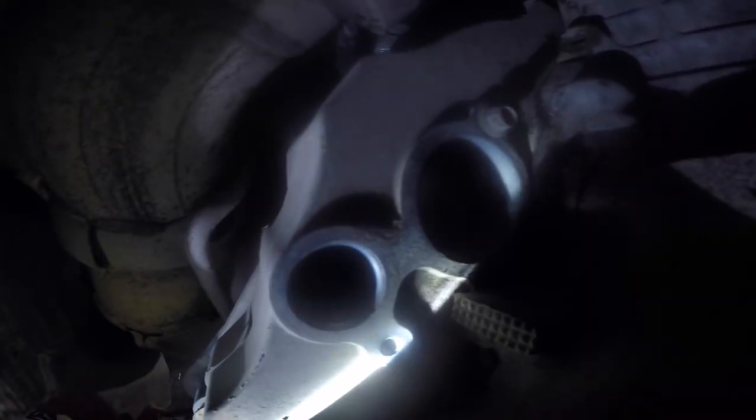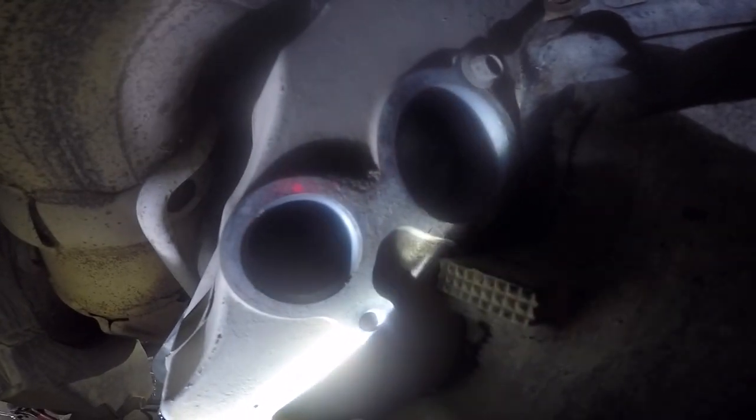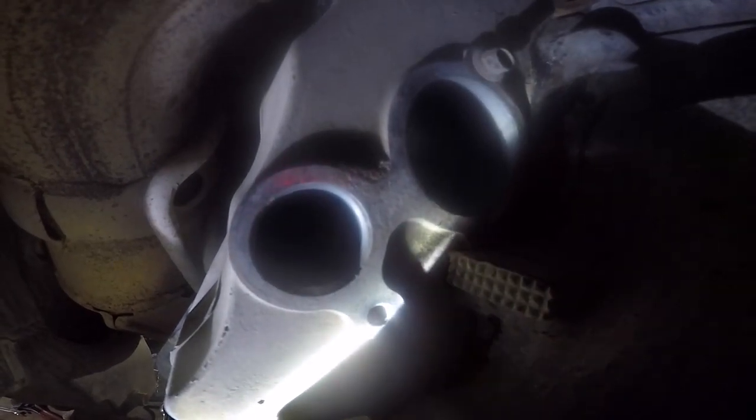All right, we're gonna go ahead and remove this inspection plate cover. We got 3 8mm bolts. Up here on the passenger side, right up in here, if you can, it might be too dark. Here is where we're gonna get the access to the torque converter bolts off. So we got, I believe, 6 to 8 of those guys, and I think they're 15 millimeter.